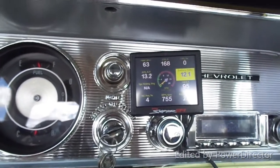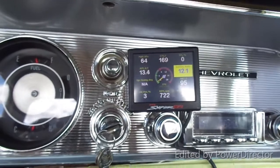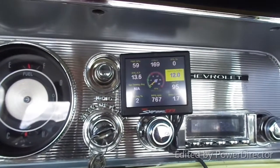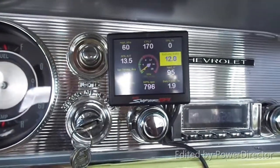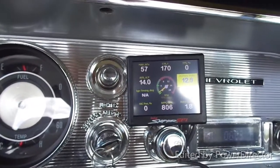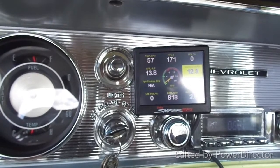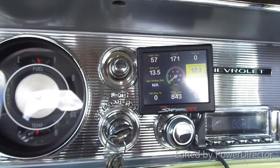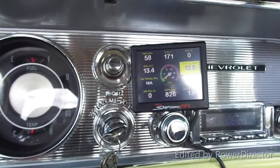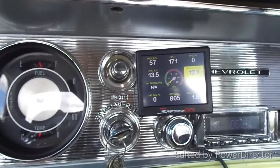You can see it's taking a draw on the battery, and the IAC did actually change — it was at zero before, so the throttle picked up a little to compensate for the AC coming on. Let me shut it off and we can see it probably go back to zero on the IAC. There it goes — idle came back up. A 100-RPM drop, I can live with that. With the carburetor I'm sure it dropped more because you could definitely tell the RPMs fell.